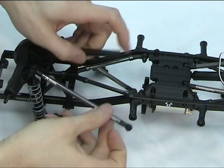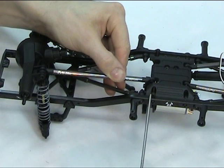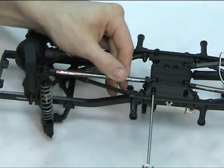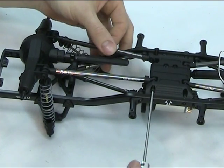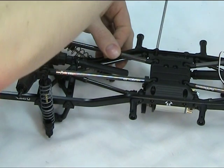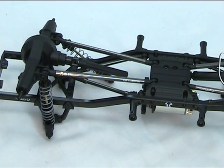For the bottom links, you need to go up in these grooves in the transmission plate. You can see there I've just wound a little bit too much on. They'll drop inside and then you can just tighten those up. The other one will go in the other side and again a few turns will just secure it. I'll tighten both those up and then we'll come back to fitting the drive shaft.